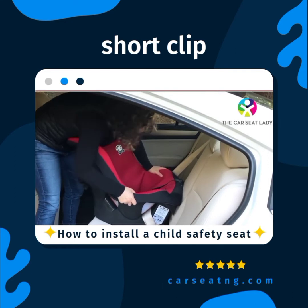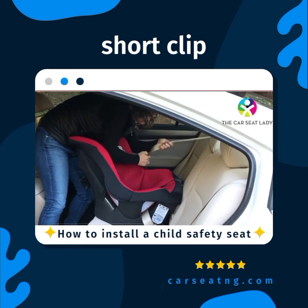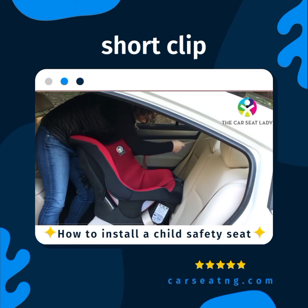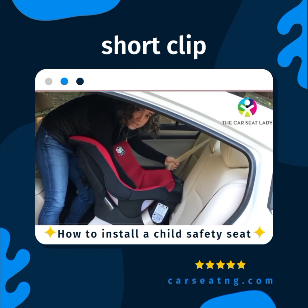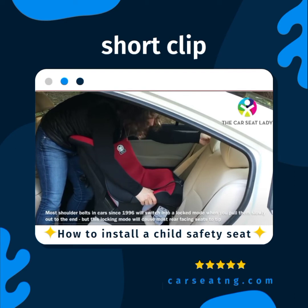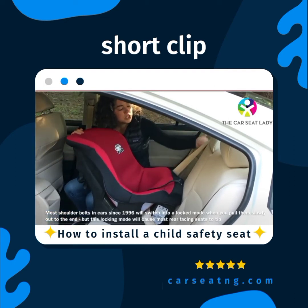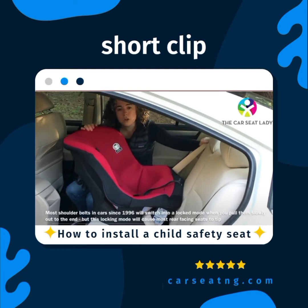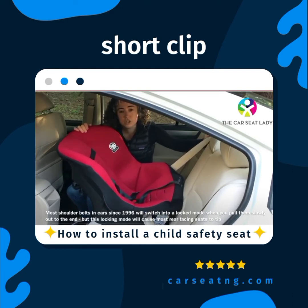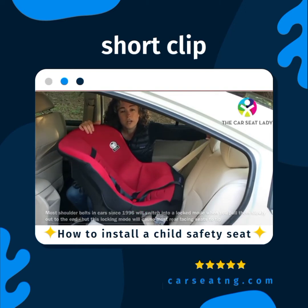Once you've done that, it's often helpful if the seat belt has its own locking mode — pull it slowly to the end and then let it back in. Hear that ratcheting? That's the seat belt's own locking mode. It's helpful to use that at first. The reason we're not going to use it as the means of keeping this car seat tight is that all the tension is upwards in the shoulder belt, and on a lot of rear-facing car seats all that tension starts to tilt the car seat on its side — it keeps tilting and won't straighten out.